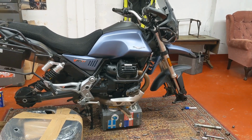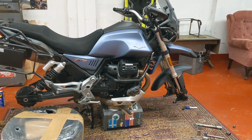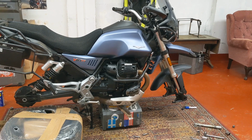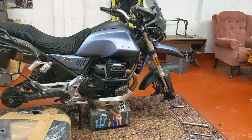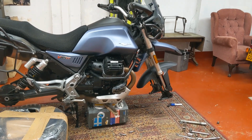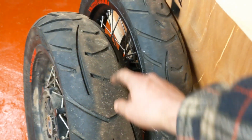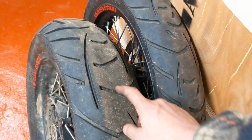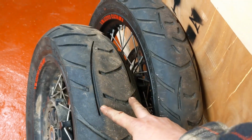I think in the haste and panic of being at the side of the road, you'd take great chunks out of your rims. So yeah, a good move to fit tubeless for next year. There are solutions that you can fit to make a tubed rim tubeless. It essentially involves, once the tyre's off, putting a wax bud over each of the spoke holes, and then wrapping it around with a very adhesive tape.